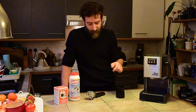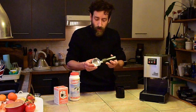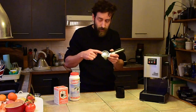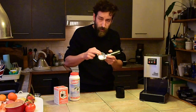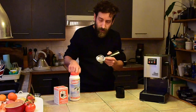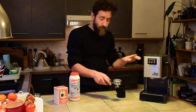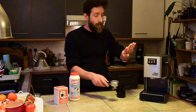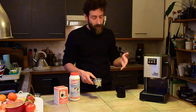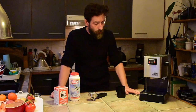It's basically, like it says, backflush. Instead of your coffee going through a filter, you put a solid one there. Instead of coffee, you put some cleaner in it, turn it on, so it goes back through the machine, out the pipe there, backflushing the system. But I'm not going to get onto that in this video. Today is solely on descaling.